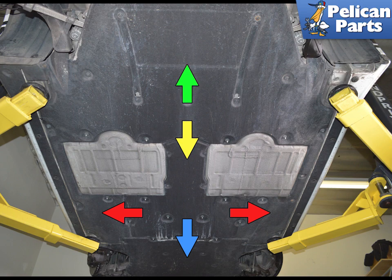If you leave the system closed and work very quickly, you can replace this sensor without a lot of coolant loss, and then run the vehicle in the bleed mode to top up the lost coolant. Otherwise, this is a really good time to give your system a complete coolant flush and fill.